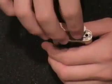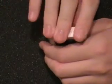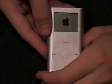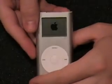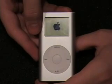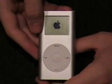Go to the top, grab that piece, line it up and snap it down into place. Once you get those plastic pieces back on, you may want to run a blow dryer over it again for a few minutes on low heat to re-bond the adhesive. Here we see the Apple logo — that's a very good sign once you've replaced your battery.